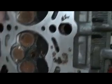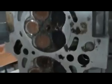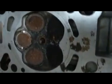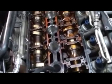Okay, but these generally bend first. These rarely bend. Okay, these will bend second. These rarely bend. So we got to see what you want to do, Chris. Got to see if you got any cracked pistons because of the valves hitting. But so far we're looking at a turbo, head reworked, new valves, timing belt kit, new belts. Them are obviously been sitting for a long time.